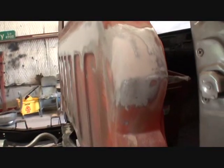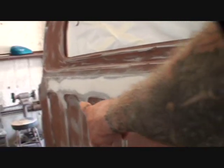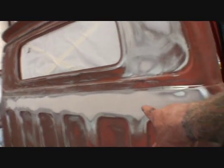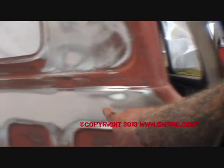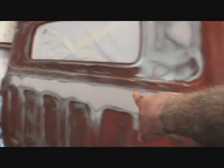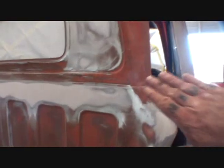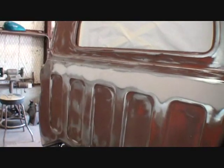And then this cab corner — same thing. Had dents going up and down it. This is pretty common on these old trucks right in this area — this is where the bed would meet up with the cab. When people throw stuff in the bed, they might accidentally hit the cab itself and put dings all the way across. There was a bunch of little dents starting here and going all the way down. So it's better to fill in each individual dent, and then on the last bondo coat, you want to swipe the whole thing and block sand it out. That levels all those little dings and dents out.